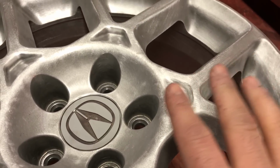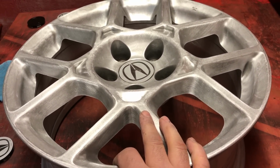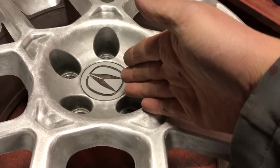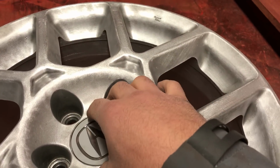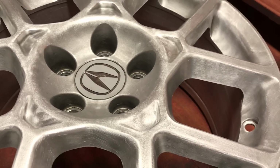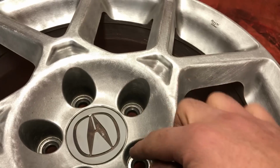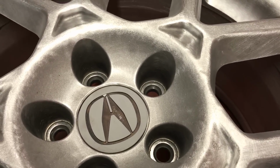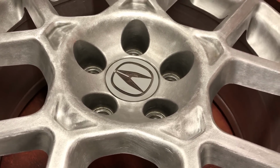And I also activate the rim with the powder coat gun, so I ground it out, so the whole rim is attracting the powder. So when I shoot the gun here, it's absorbing it downwards in this general area, even though the plastic does not have the absorption, because all around and underneath it's pooling, the powder ends up going onto it, and as soon as it touches it, it starts to stick and melt because of how hot I make it. That's pretty much it.